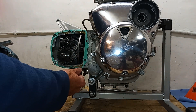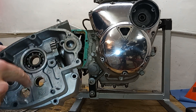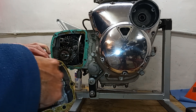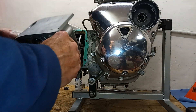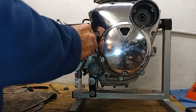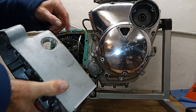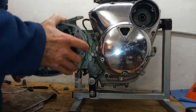So I've put my gasket on, my well seals on, the gasket's on, quadrants in, bearings in, and we've got the thrust washer on the end of the layshaft ready to go. So we're going to put this on - just simply slide it on. There are three shafts to engage: the main shaft, the layshaft, and the selector fork shaft, so it can be a bit awkward to align up.